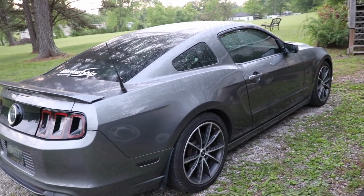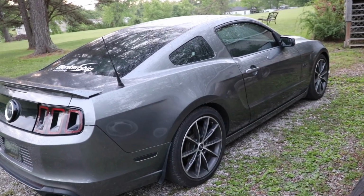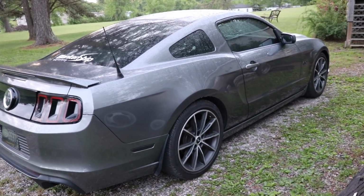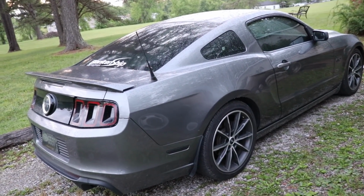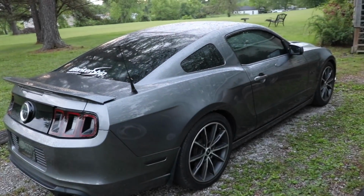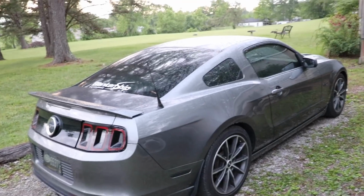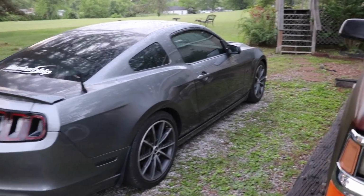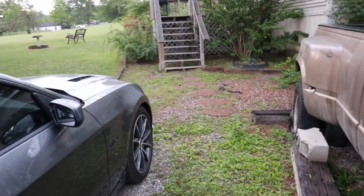But guys, we're just going to get out and data log it here real quick. We've got to do a 30-second idle log and a steady state RPM cruising log. We're going to do about a 5-minute cruising log, and then we might be headed to Mexico tonight, not in this one unfortunately, because of street tires, rain and base tune life. But we're going to get there, and I'll show you all the fender exit exhaust up here, and then old buddy can start it up.